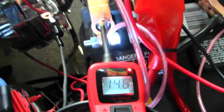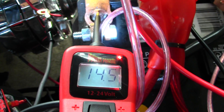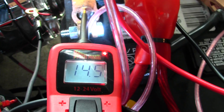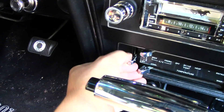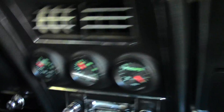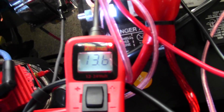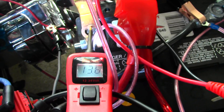Let's go ahead and start giving this alternator some competition and start giving it some draws. Let's first throw on the fan. You'll notice that it stumbled there — it realized it needed more voltage. It detected a 25 amp draw and kicked up the voltage regulator to still output 14.5 volts. That's ideal. Now let's give it some AC and see what happens. I'm just going to turn the AC on to a normal standard blower speed. We're down an entire volt — we're still running at 13.6, which is 0.5 over what it should be, but we're not at an ideal 14.5.